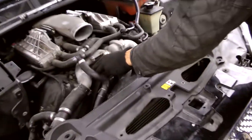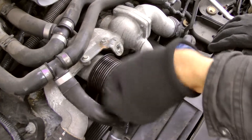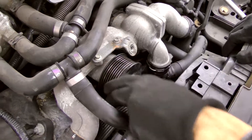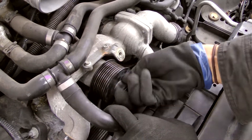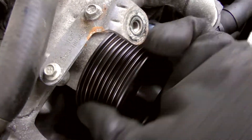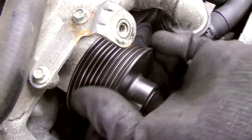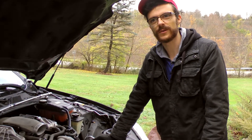With the help of my roommate, we got the pulley loosened up and the belt off in a very non-conventional way. Let's see if we can hear any rattle with the supercharger. I'm not hearing a whole lot, which might be good. You can kind of hear the blades inside moving back and forth, but that's about it. You can hear a car coming down the street more than the supercharger. I thought for certain it would have been something like that. We got air coming out, but I think the supercharger is good — there's no rocking and rattling going on from what I can tell.